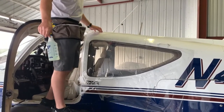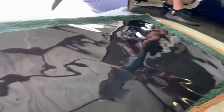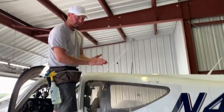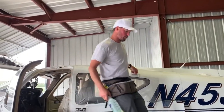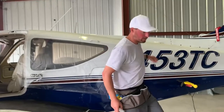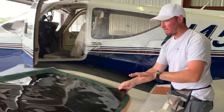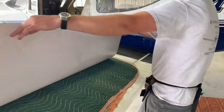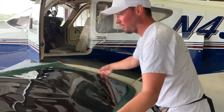So that's the face of the tint — the glue is on the underside. Since we're templating from the outside of the airplane, we want to put the Sharpie side down, because once it goes in, the glue faces inward. It's kind of a reverse template. If you template from the inside, you'd put the Sharpie side down the other way. The key is that the glue needs to go on the inside of the airplane.